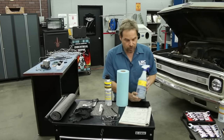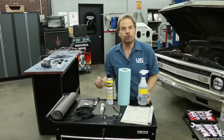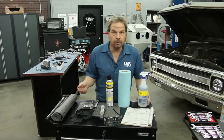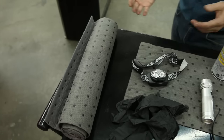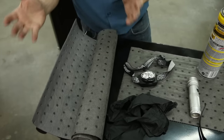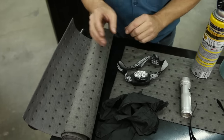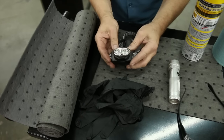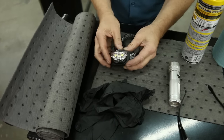Some plain water will neutralize the brake fluid in case you spill it on paint — you can keep it from eating the paint off your vehicle. Since brake fluid is going to leak out, some absorbing mats are easy to find at the parts store and they'll come in handy and keep things clean and environmentally friendly. A headlight, as goofy as it looks, is a really good idea and keeps your hands free to work while you're underneath a dark vehicle.